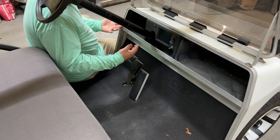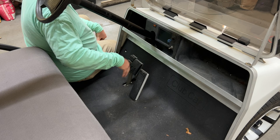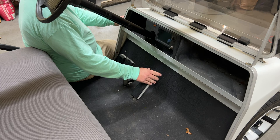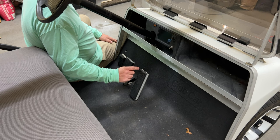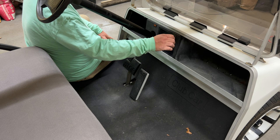Another question I've gotten is: why not just hook it up to the controller side of the solenoid? Here's why I wouldn't recommend that. The golf cart is on but the solenoid hasn't activated yet — you still have to hit the accelerator pedal to activate the solenoid. It clicks on when you press the pedal and off when you release it. So if you're running the 48-volt side of the solenoid it's only on for the duration the pedal is pressed. The solenoid is basically a safety device — very similar to what we're doing here but with a relay.